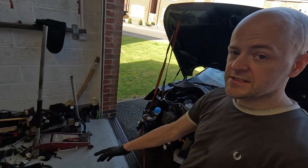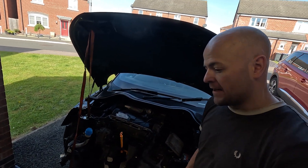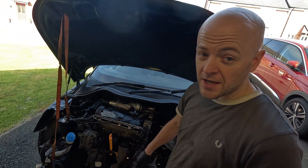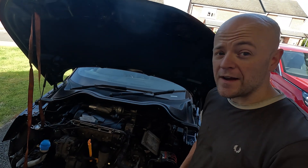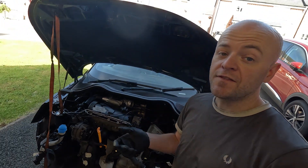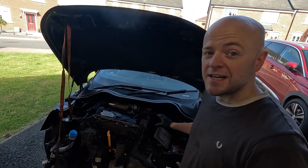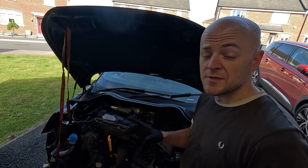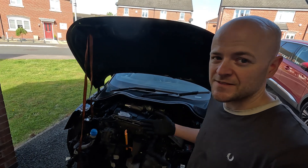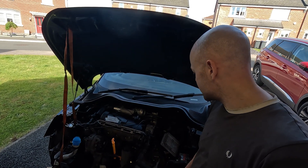More onto the electrics now. It's not as straightforward as I thought - I'm potentially going to have to leave the A1 ECU in but just with one plug. It's probably only down to the ABS. As far as I'm aware, the ABS is working with nothing plugged in and just one plug on the ECU. I can communicate via an OBD port and make the ABS pump run for priming, so I know it kind of works. I assume the speedo potentially works because it would work off the ABS via the ECU - could be wrong, but that's common sense at this point.